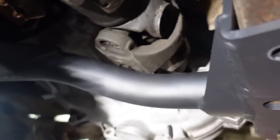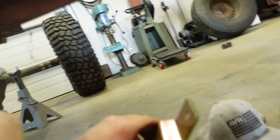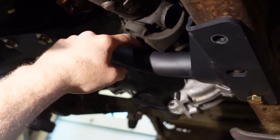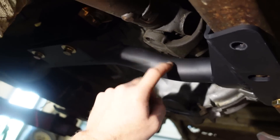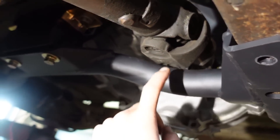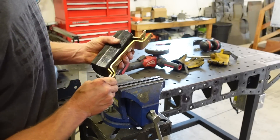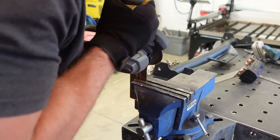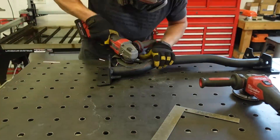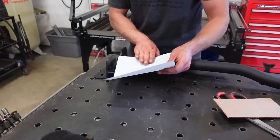We got everything in here and you can see it is barely rubbing on the top of that crossmember. That's not enough to make me want to rebuild the entire crossmember. What I got is that poly mount came with this little plate here. I'm going to raise up the tranny about an eighth inch, then pull this crossmember out and just cut this out a little bit, get some quarter-inch plate and weld it in there and drop that down maybe just a half inch to make sure we have plenty of clearance. With quarter-inch plate welded in there it's honestly not going to be any weaker if we do it right.